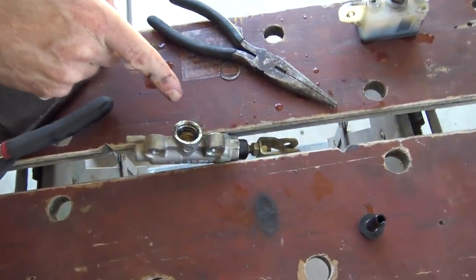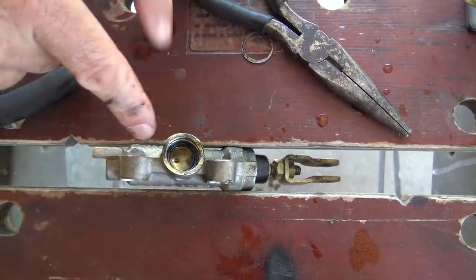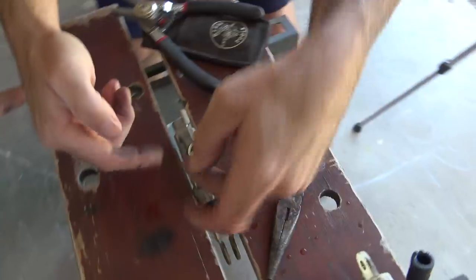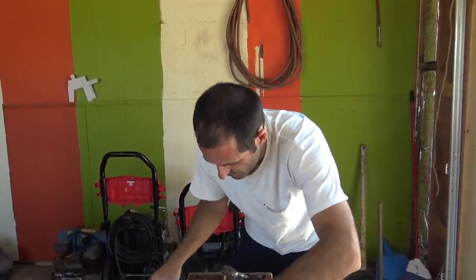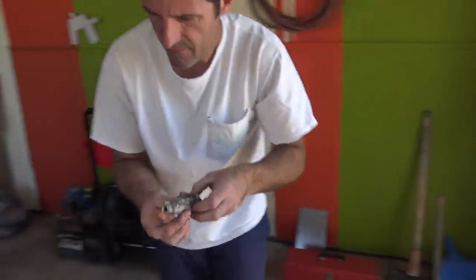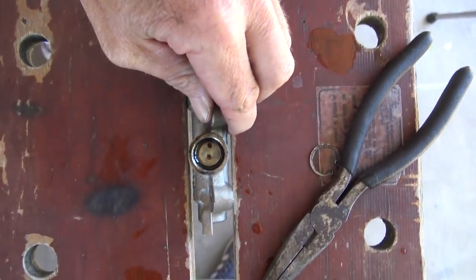We might not have to take this all the way apart. There's some clear brake fluid in there, but there's also some garbage in those two holes. Those two holes take in and recirculate the brake fluid in the master cylinder — they should be clean. So I'll dump this out and get a better look. Those are dirty.